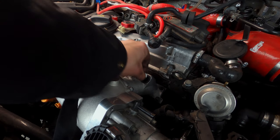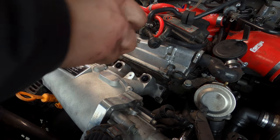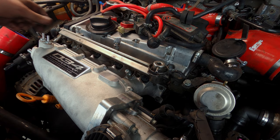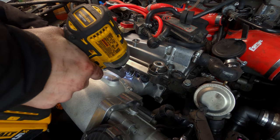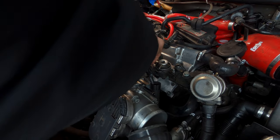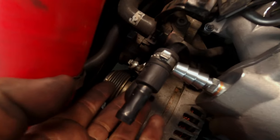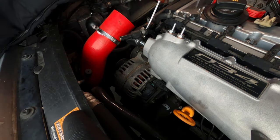We're at the stage where we can reinstall the injector. Reinstalling the fuel rail and the harnesses is exactly like removing it, except in reverse. The only difference is you're going to want to use a washer when you bolt the fuel rail down, just so that it fits properly. You're also going to want to replace the O-rings at the bottom of the injectors. This connection looks like it's not really going to fit, but it actually fits just fine if you bend it slightly. This part of my PCV system is brand new, so the rubber is still really pliable and it doesn't kink any of the hoses. Long term, I'll get a right angle tap though.